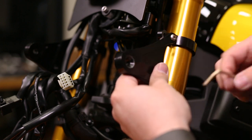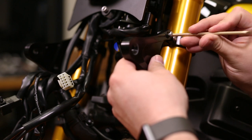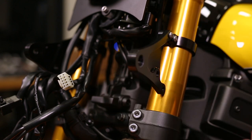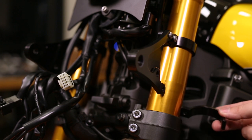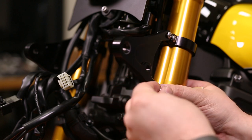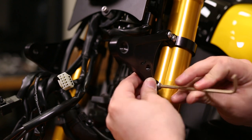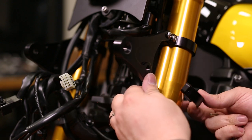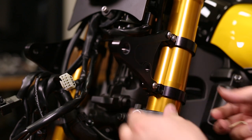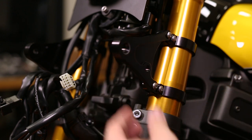Take the side bracket and another one of the bolts and lightly install it into the top fork ring. Then take the bottom male half of the fork ring — this is going to show us exactly where we need to put the bottom ring. Go ahead and loosely install that. Now take the bottom female fork ring, slide it on from the back, and loosely install the last screw. Repeat this on the other side.